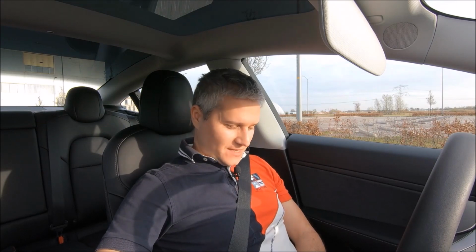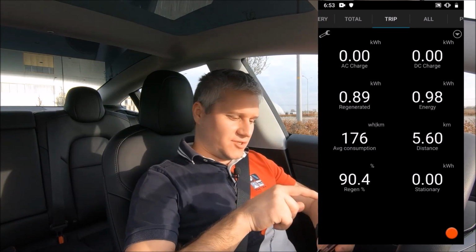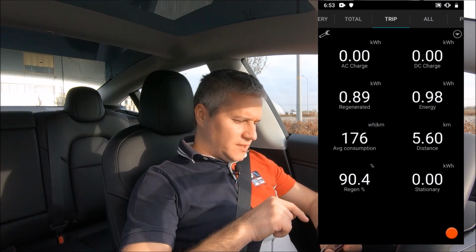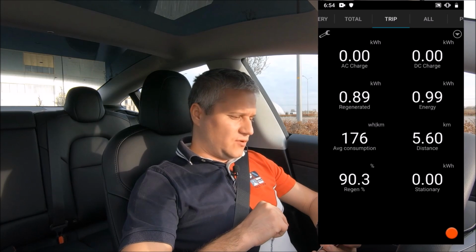Yeah, so I hope you enjoyed that. We're back here with Scan My Tesla, and let me share with you some statistics. So you can see in this very short trip, we did 5.6 kilometers. We consumed a total of 0.98 kilowatt hours, and we regenerated 0.89. So that's 90% of energy we regenerate. I was driving a little bit aggressively just to show you that even when you bring the car close to a stop with just one pedal, the car will still stop, because that regenerative braking is quite strong.